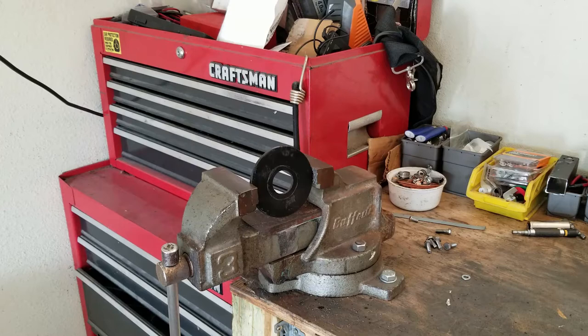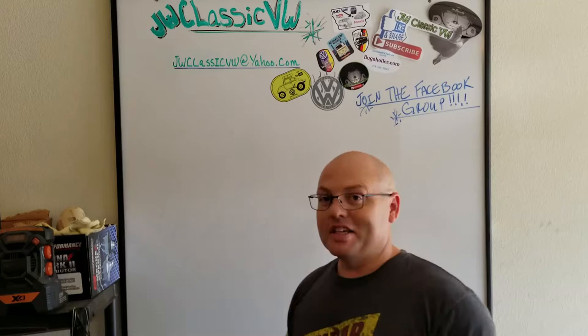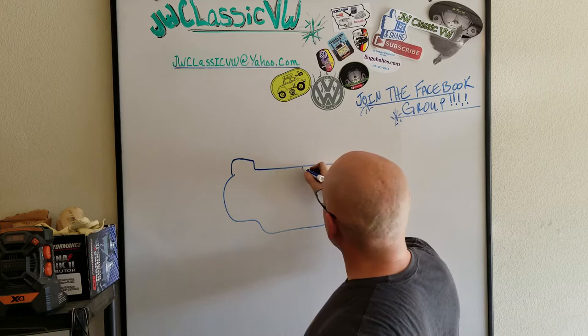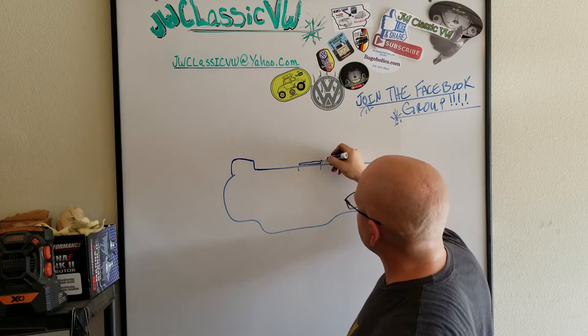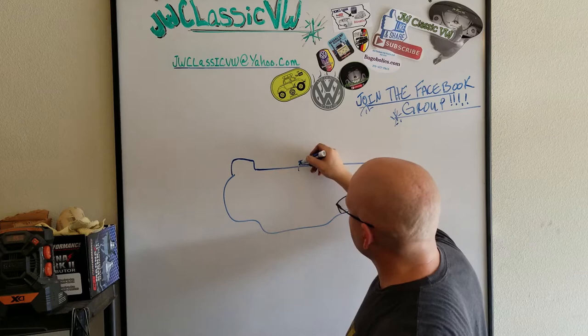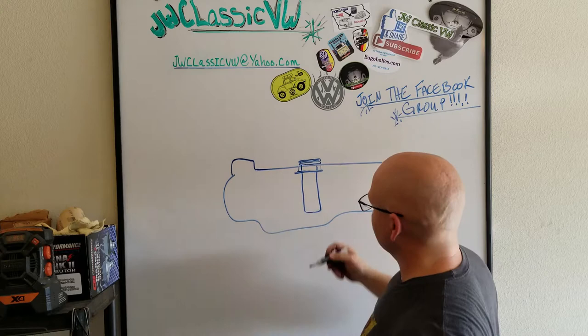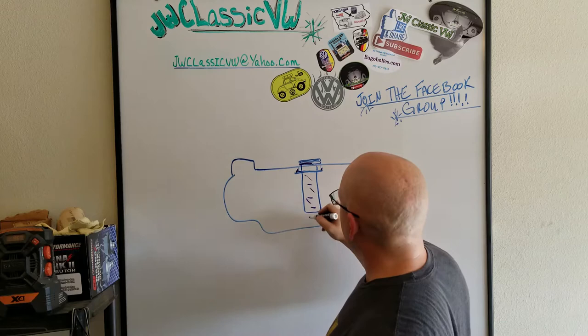So, here we go. All right, to make it more clear, I'm gonna go ahead and illustrate it for you guys real quick how this actually works. Let's see if I can draw this. So here's the gas tank inlet, gas tank. So there's my fuel tank, and my sending unit's gonna be right here in the center area. Well, I think that's where it's gonna go right now. We're gonna have the rubber gasket that's on the outside, and then we're gonna have the actual sending unit itself. We'll just darken that in a little bit. Sending unit comes down in. And what we're making is a metal washer that'll go right here, allowing me to sandwich the actual top of the sending unit here between the gasket and the new washer. Yay! I'll be able to tell how much gas I have.